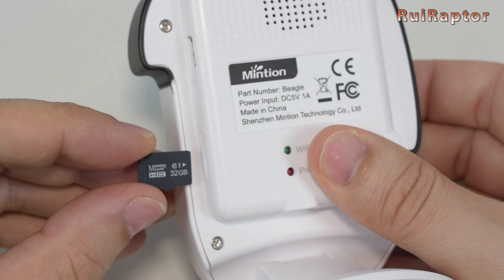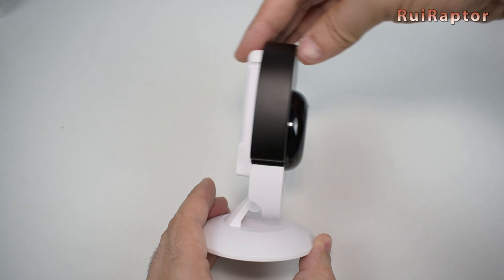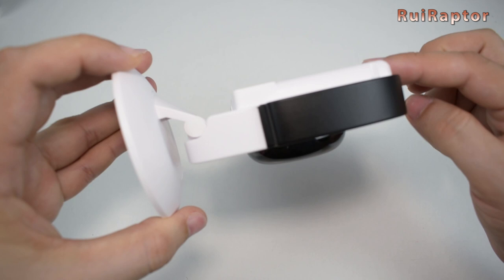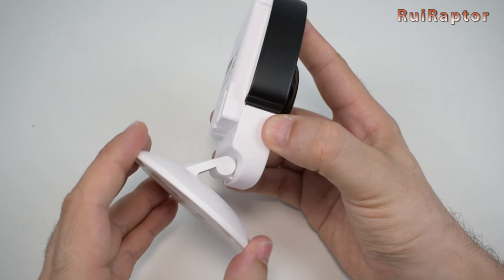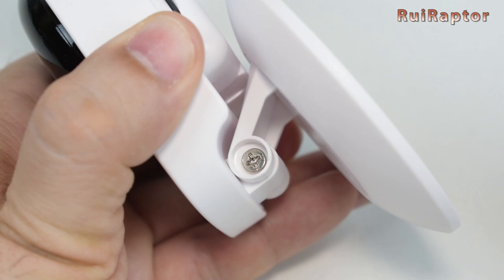The camera comes already installed on a small mount and you can rotate and tilt it. Under the mount there are a couple of holes used to secure the camera. If the mount is not holding the camera very well, it's also possible to adjust its strength. If we remove the white caps from the mount, we will uncover the nut on one side and the screw on the other — this is the screw we need to tighten a little bit to prevent the camera from tilting itself from the weight.